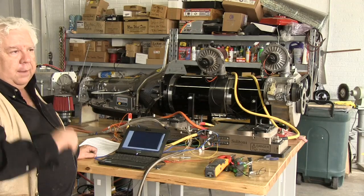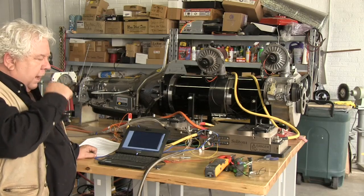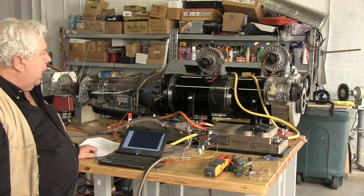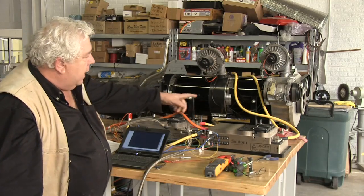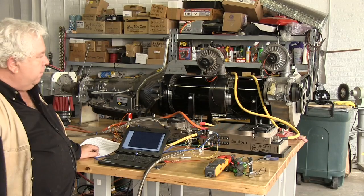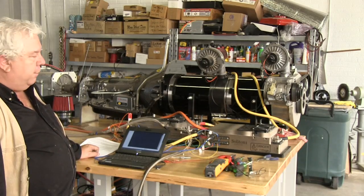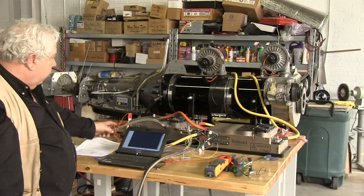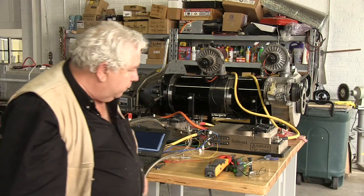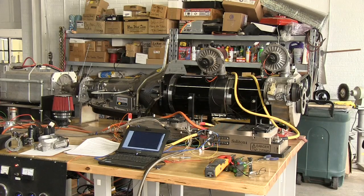And we're going to use the key and the signal to the starter motor as our start signal. And I want it to bring up my motor and get that reluctor ring turning and notifying my ECU that I'm running. And then I'll release the key just like I normally do, and it'll be on, and we'll have our 12 volt ignition there. But see what's rattling around here. Yep, no, it's running very, very smoothly.